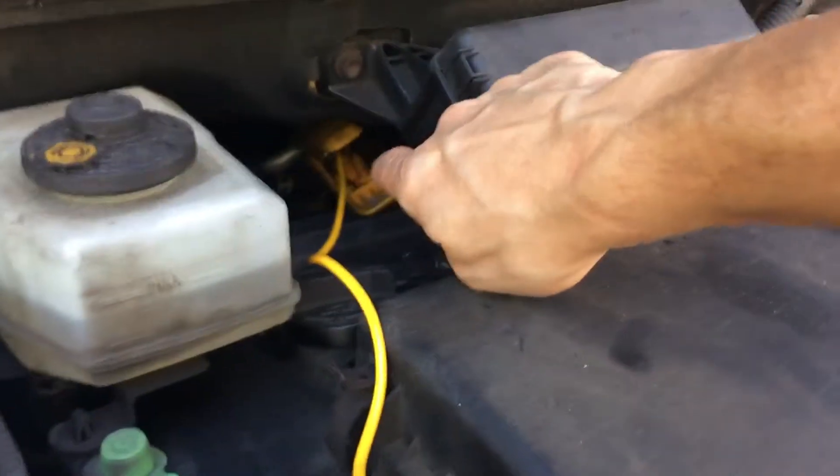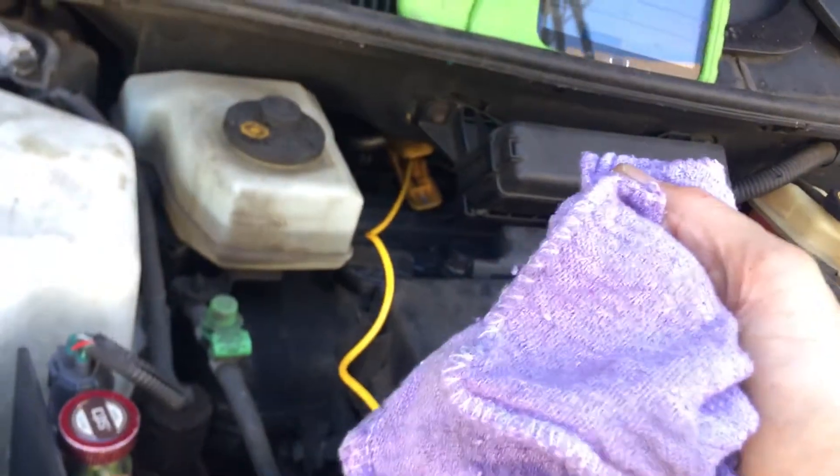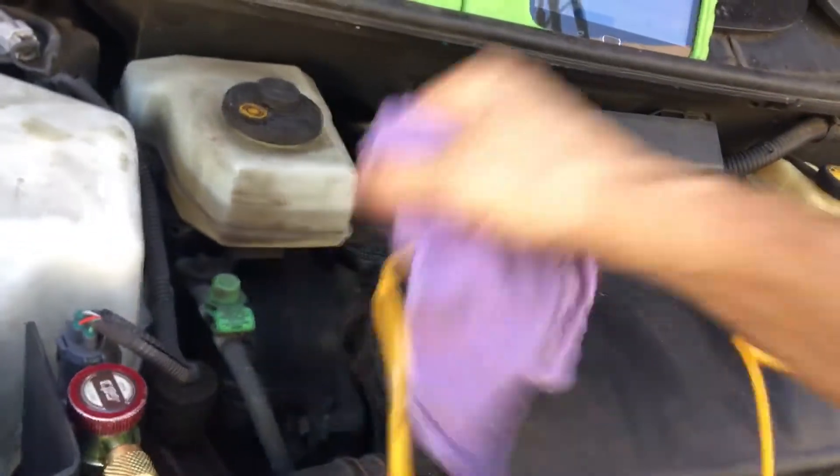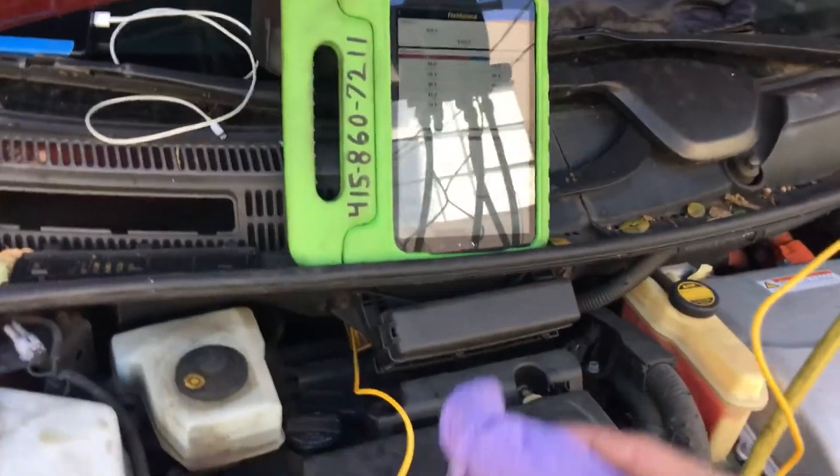For this reason, I'm taking the subcooling over there and I'm right by the exhaust manifold. I do not have insulation to protect my thermistor — that's part of the gauge — against the radiant heat of the exhaust manifold, which is very hot back there.